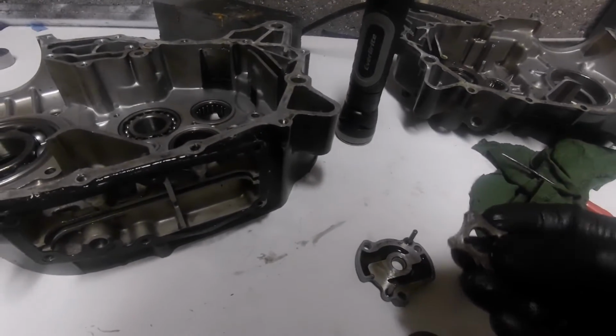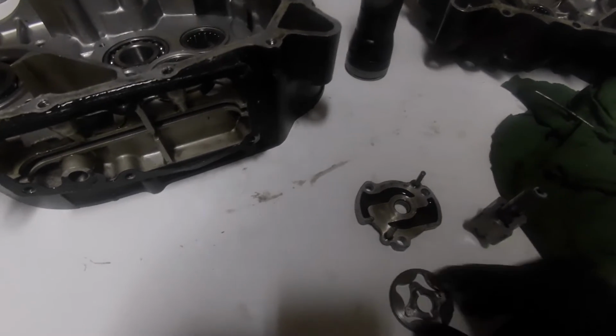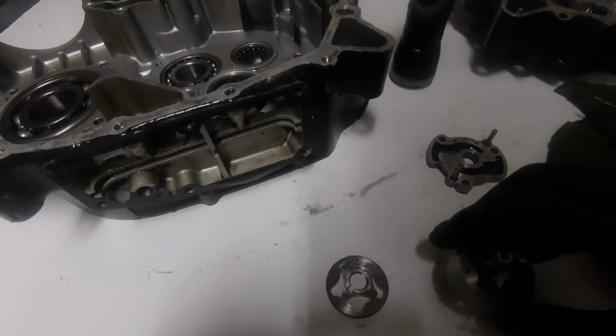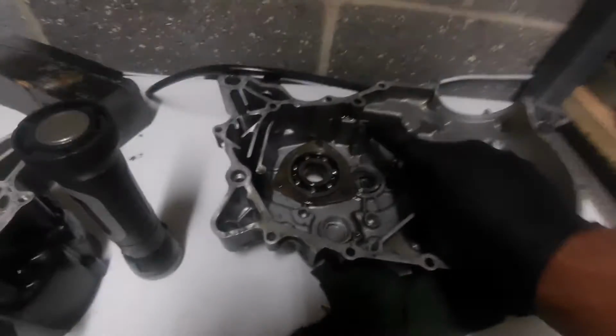Let's just get that right. And there's another mark again, as I said about marks. There's the little arrow on there and the little arrow on there. So there's our oil pressure pump. Okay. And there is our scavenge pump, if I can get that in there. Oh yes, right. So we see the difference. So if it's feeding the pressure pump, we have to bleed some off. I get that.